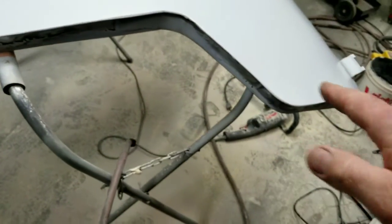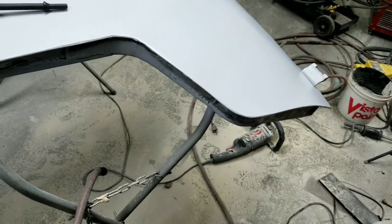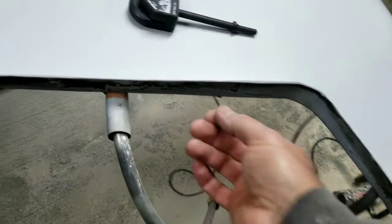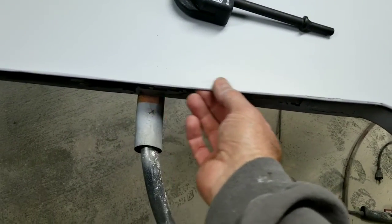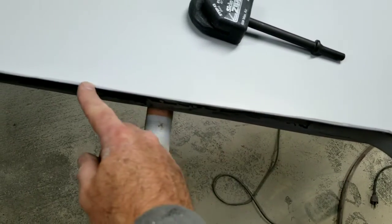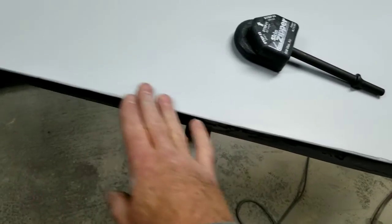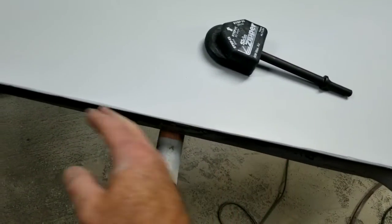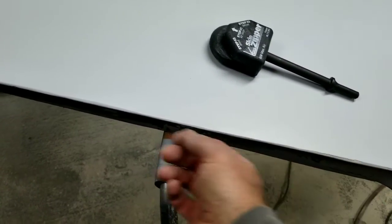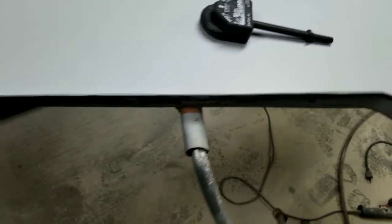I did this one with hammer and dolly. The reason I did that is because a lot of you don't have this tool, and the hammer and dolly works fine, but you do end up, if you notice here, it looks kind of thick. It's not filler. The filler is almost gone, right? There's almost no filler on there. Of course, my sanding is a little funky. Again, this all gets blocked, gets a second coat, then I go through and I'll touch up all this little stuff like that with glazing.